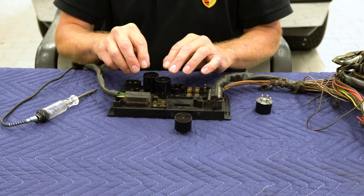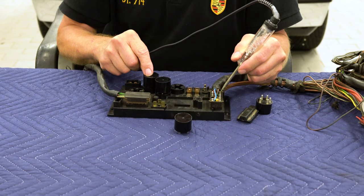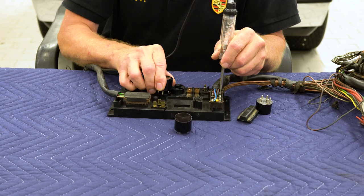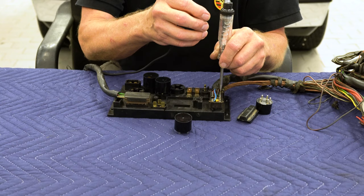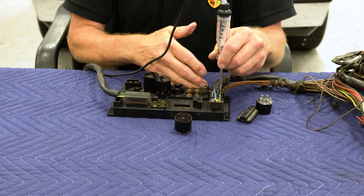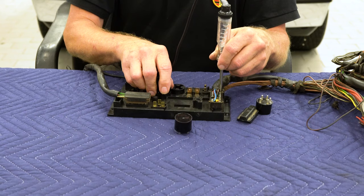If I hear the main relay clicking but still don't hear the fuel pump running, I would go to the front harness connector. Remember, I've verified that the fuel pump relay is good. Usually by now you've got it running because one of the relays was not making connection — it was corroded in here, you've cleaned it, you're back on your way. But if not, we pry off the front harness connector and the left front pin, which is black and red — this goes right down to the fuel pump and comes right off this fuel pump relay. With the fuel pump relay in place and my test light here, key on, condenser disconnected, I'm unplugging and plugging the relay to make sure I get it squarely in there. Every time I plug this in, this test light should light and go out, and the injector should click. If the test light lights and goes out, I know we have either a bad fuel pump connection, a bad fuel pump, or the ground lead at the firewall just behind this relay board is not making connection. If the test light does not light and you know the relays are good, you have one of the rare conditions where your relay board is bad — but that is one in 10,000.